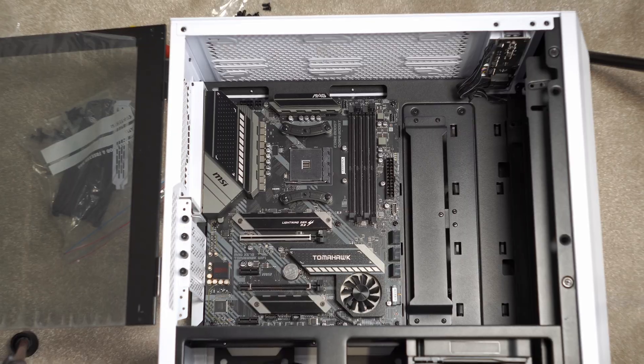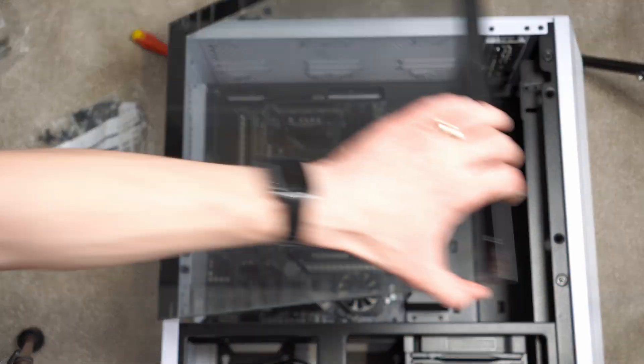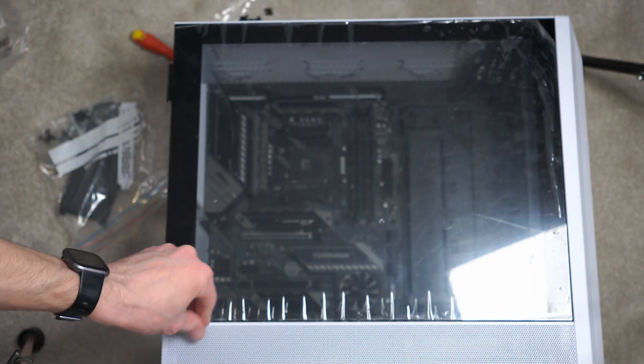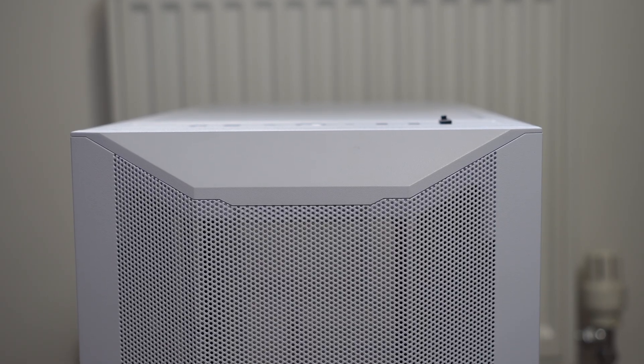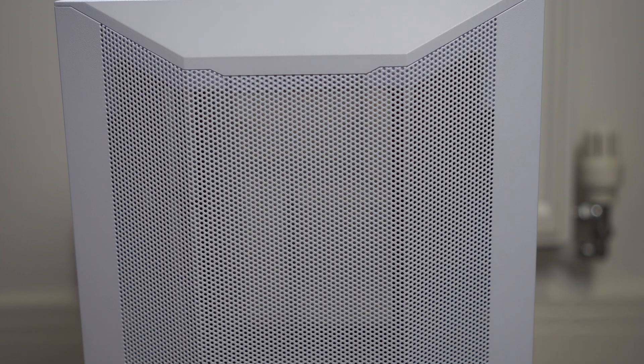So there were two things I did. Firstly, I kept the side panel on the case as much as I could, which will help prevent some of the dust getting in when I'm building. I literally had the computer there while building on it with the side panel on to prevent any dust falling into the case. The other thing you can do is, if you're not building on the system right then and there, keep the computer case upright — there's less chance of dust actually falling into it. But it's not really ideal to have it completely exposed.